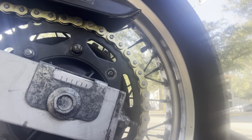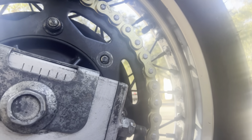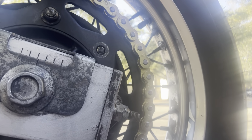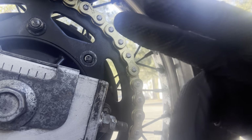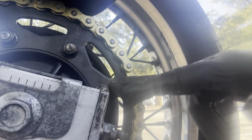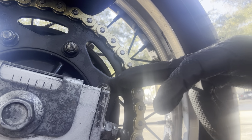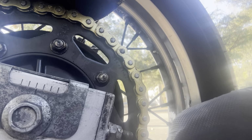As you can see right here, when I was torquing down these nuts on these studs for the wheel hub assembly, just torquing it down to the recommended 24 foot-pounds snapped this stud clean off. And not only that, there were 2 or 3 more that felt like they were twisting. I couldn't torque them down to 24 foot-pounds. It just kept twisting, and if I went any more, those would snap off too.